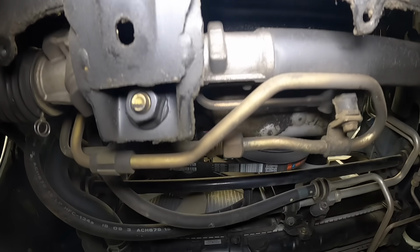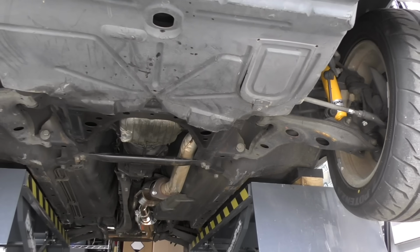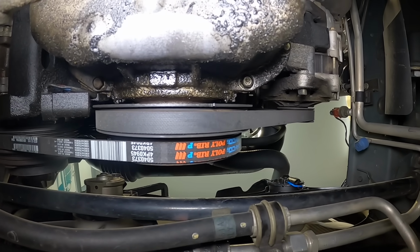First up, we need to determine that we actually have an oil leak. I've seen tons of oil leaks go unnoticed by vehicle owners because that oil leak never actually made it to the ground. Maybe there's a belly pan underneath, or the oil's getting caught in the subframe, or a well on the transmission or on the engine. Just because we can't see those leaks doesn't mean that we get to ignore them.